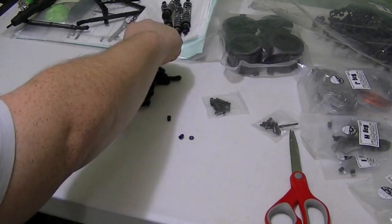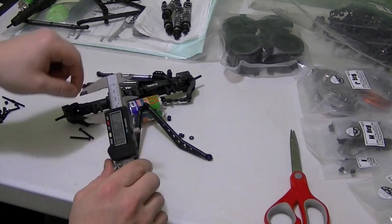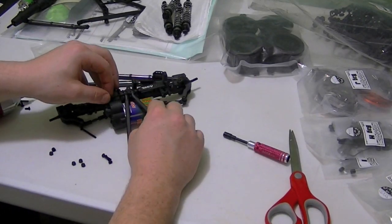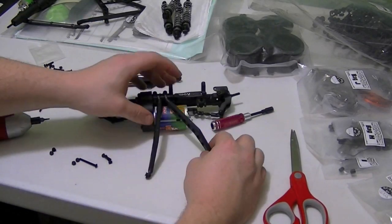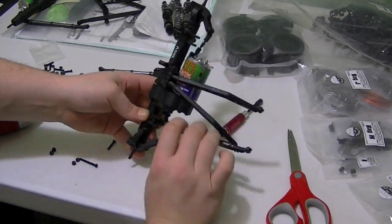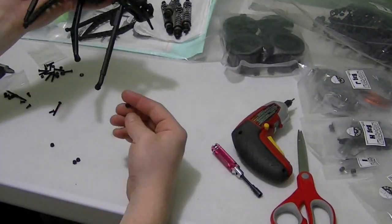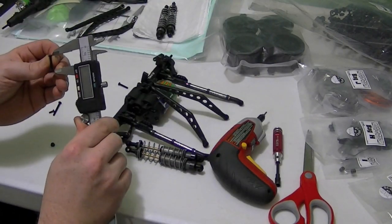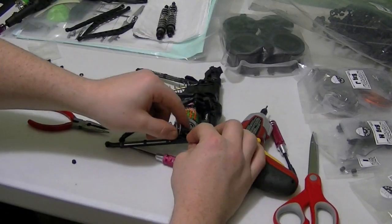Let's start putting those links on the axles. And there's the caliper I was telling you about — I wanted to make sure we had the right screws, didn't want to have to take anything out. I'm going to have to change these afterwards though — I put the high clearance links in the wrong direction. The short piece should be to the rear of the axle. Short links underneath, or the straight links I should say, same on both sides. We got the shocks mounting — they're just going to be above the straight links. Some of this stuff is kind of hard to get at; you need those needle nose to get in.